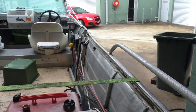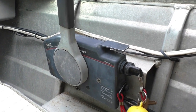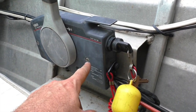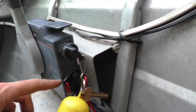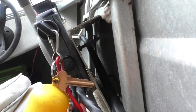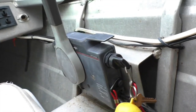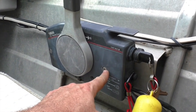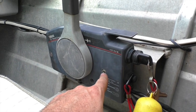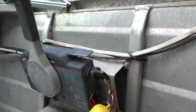The next thing we'll do is go and disconnect the other end from the helm. These forward controls are usually held on by a couple of screws — in this case we've got one here and one up here. They're actually bolts with a nut on the other side. If you're looking behind there you'll see it's a quite long bolt with a nut and washer on the back. What I'm going to do is put a screwdriver on here and a 10mm spanner around the back, and then wind these two bolts off, which will disconnect this whole control unit from its mounting bracket.